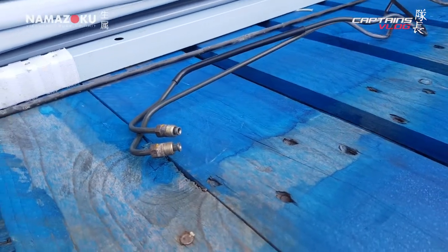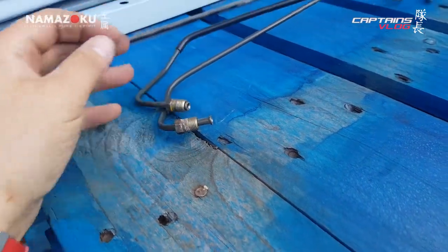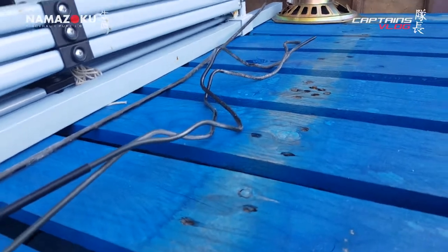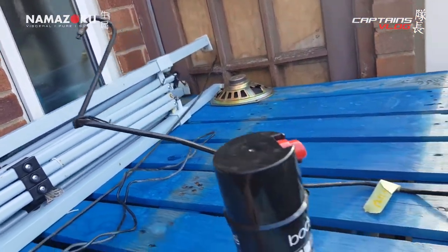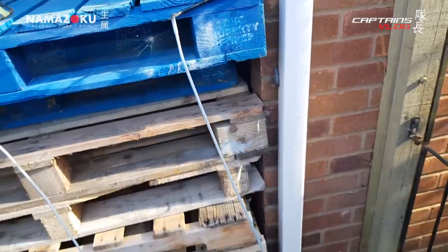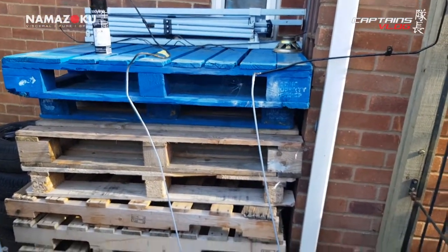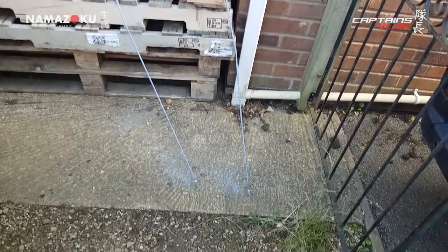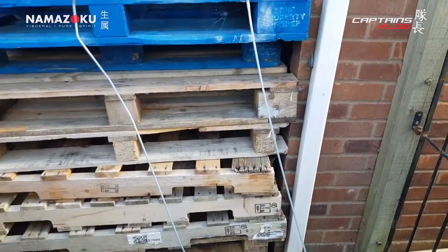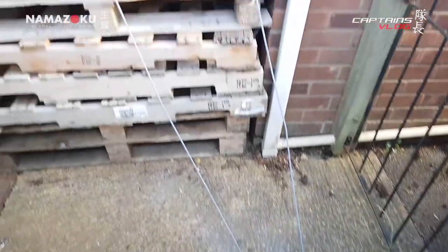There's no turning back now. That's the ends of the rear brake lines that were in the engine bay, and that's the old evap line or some of it at least. The rest of the brake hose pipe is here - you can see they're sitting in some primer right now. There's a little bit of very mild surface corrosion so I've sanded it right back down and used a general rust remover to eat it away. We've got some primer on it and we'll get some satin black on that just to protect it.